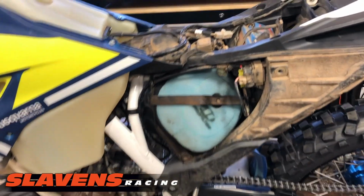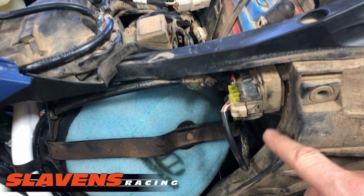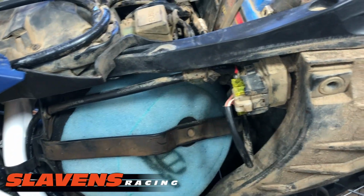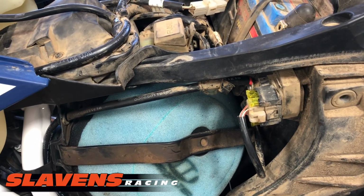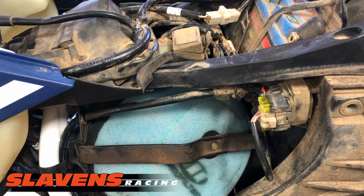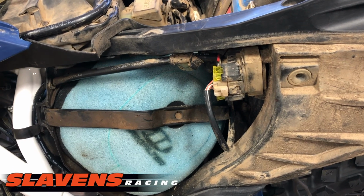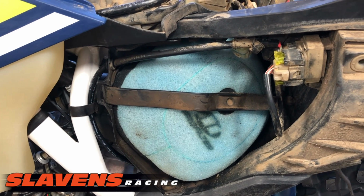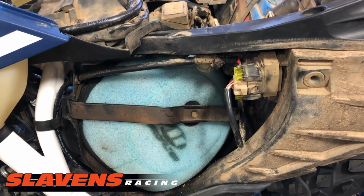And so we looked at all the fuses first. There's fuses here and down here. These are the ones for the starter solenoid, because this is the starter solenoid right here. It has this big cable hooked onto it. That's the battery cable. All the fuses looked just fine. They looked fine, they felt fine. Sometimes you can grab the prongs and wiggle them, and sometimes that will tell you if there's maybe a connection issue in there, if they wiggle when they're not supposed to. But ultimately, in the short amount of time we had in the parking lot, we failed and didn't find the problem.